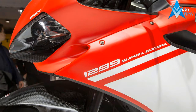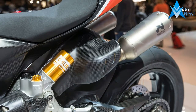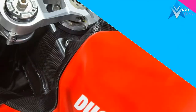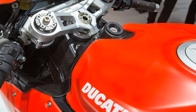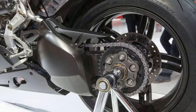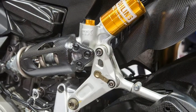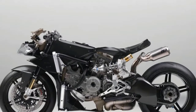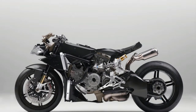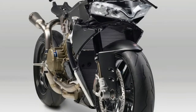Mated to that engine is a carbon fiber monocoque frame and swingarm, which have 7075 aluminum inserts co-laminated into the structures. Each piece contributes to pretty significant overall weight savings, the frame cutting a claimed 3.7 pounds, and the swingarm an additional 2 pounds. Carbon fiber wheels save another 3.1 pounds and offer less rolling resistance — 26% less up front and 44% less out back — while the updated Öhlins suspension drops another 4.1 pounds.